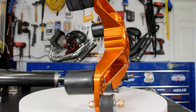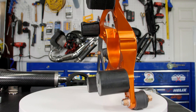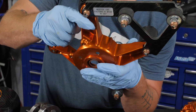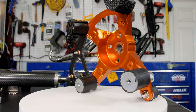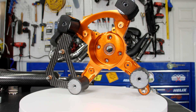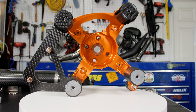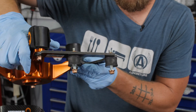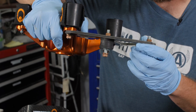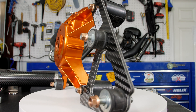Let's talk about the Carter support. The Carter support is also 7075, 5-axis machined — you'll see all these nice little contours. This is solid billet 7075, so this thing will last the life of the motor as well. You've got these beefy, gnarly motor mounts, which is also going to help smooth out some of the vibration. And here you see the carbon fiber exhaust bracket — it saves weight and it's super strong. This whole setup is going to last the life of the motor, no problem.